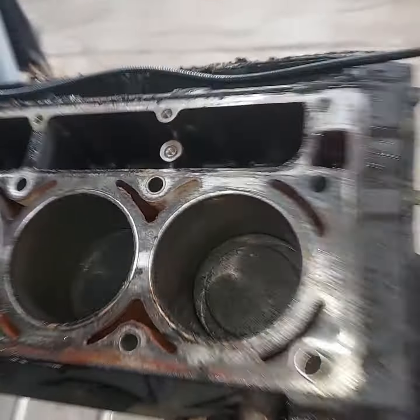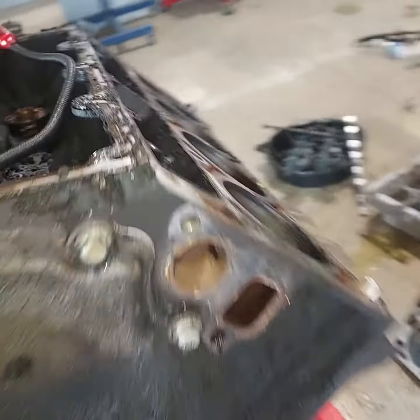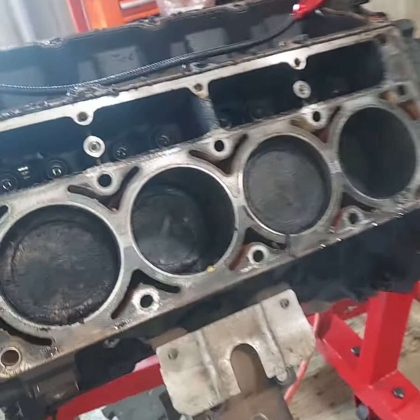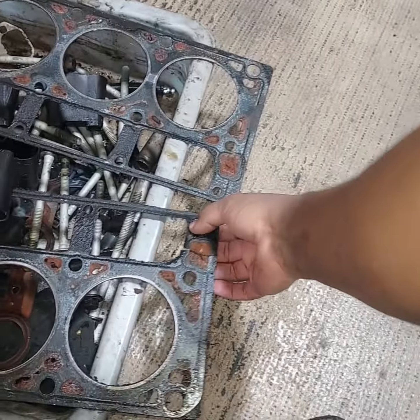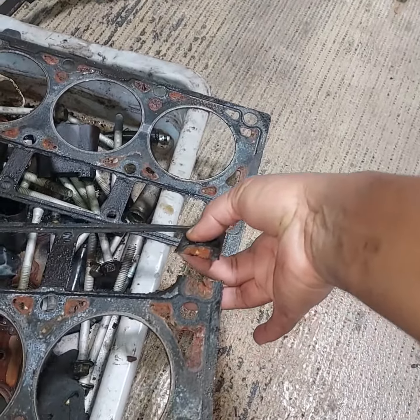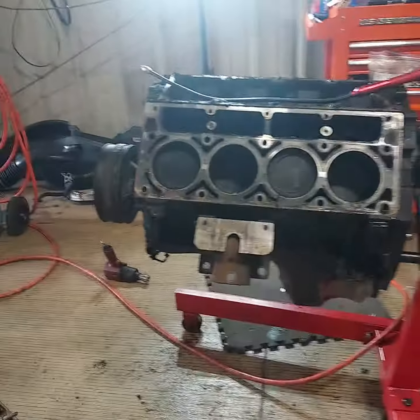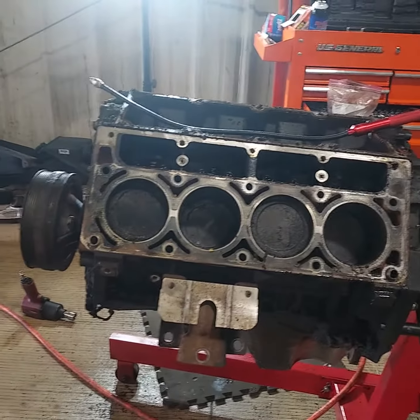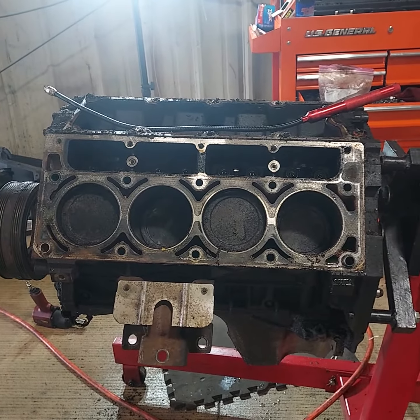Or I think the oil pump might have went bad. We're starving with oil, because they got water all in that well. They had water in this side too, and then we found a blown head gasket. It was ripped to pieces when we took it off. It was sick — this is a sick puppy here.